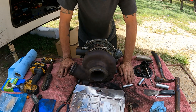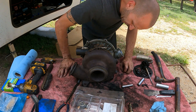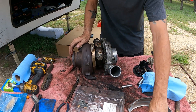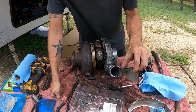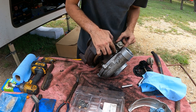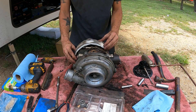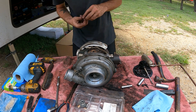The only thing left to do now is put the heat shield on the hot side of the turbo and put in the VGT. We're gonna oil up the VGT and slide it back in — you'll hear a knocking noise when it bottoms out, and then you know you're in there. Then we're gonna put the bracket on to hold it down. The heat shield goes on with three bolts right here like this.